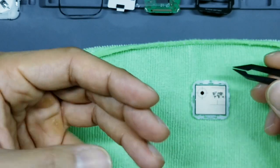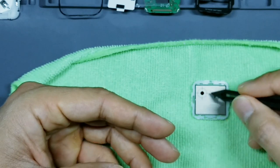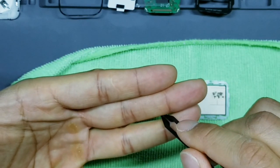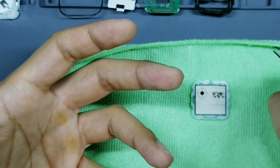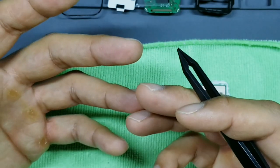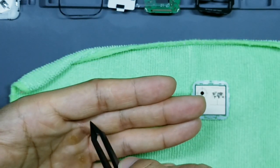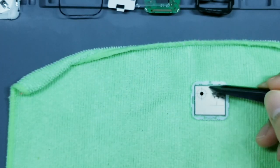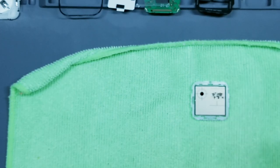The reason why we're using a brand new polarized filter is because the minute you lift this up, you expose the glue that glues these three layers together, okay? And that glue makes it look very cloudy and very dirty, which is why we have to clean it up and put a brand new filter on, okay? So now hopefully that makes sense what we're doing. Again, we're just removing this top layer off of only this portion of the display. Everything else here, we're leaving all three layers intact.